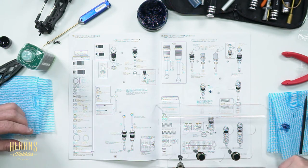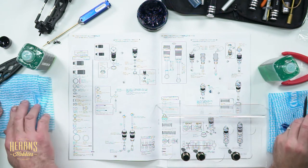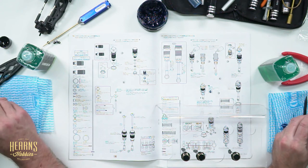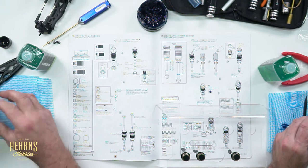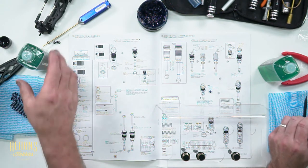And if there is, they'll take a couple of minutes maybe to come up. Do you use a shock pump or anything like that? No. They're emulsion shocks. You're wasting your time trying to get air out of them because as soon as you go use them for the first time, they're full of air again. Yeah. But it is important to keep them fresh.